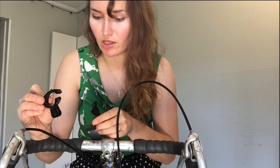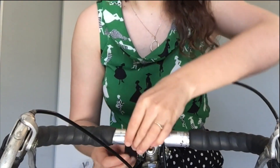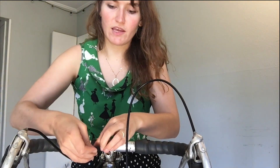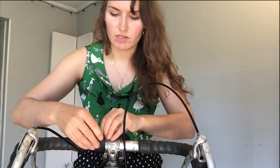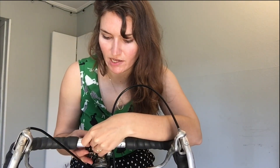The most important thing in the box is this rubber shim. This is gonna ensure that your mount has a really tight fit, which is essential to keeping it on the bike and keeping it exactly where you want it. Wrap the shim around the handlebar as tight as you can. If you want a smoother fit, you can cut the shim to the exact size you want. Your mount will adjust to the size of the shim over the course of the first few weeks or months, so we suggest that you tighten it down before every ride to ensure a tight fit.